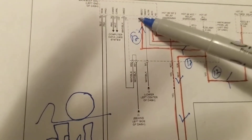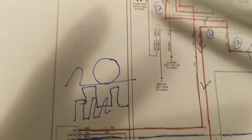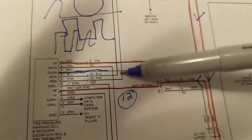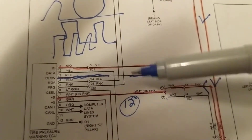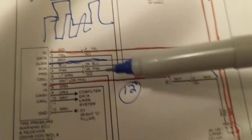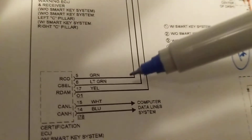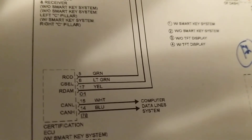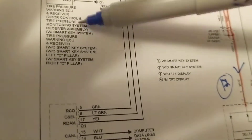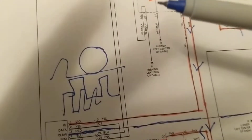The reset switch just resets the warning light. So we're dealing with the transmitter talking to the receiver, constantly sending information. They communicate via data lines — programming lines and RDA lines. There's also a clear switch (CLSW) to reset. Additionally, a certification ECU uses computer data lines to verify the driver has the correct key — the key code matches the module — just like the GM anti-theft system we discussed.